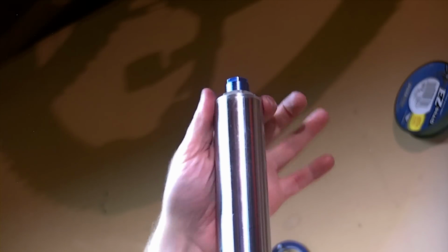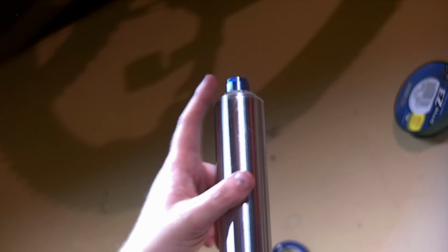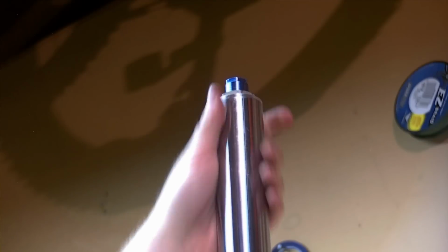Snug this down as far as you can by hand, but once we get it back into the triples, where the triples are holding it by the lower triple, we can torque it then, which is 17 foot-pounds, 1-7. Torque that cap once it's back in the triples, holding it in place for us. Again, we'll just have the bottom one, the lower pinch bolt holding it, so these threads are not being compressed, and we'll torque it to 17 foot-pounds.